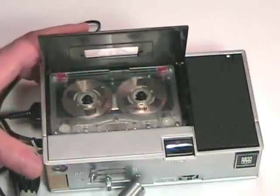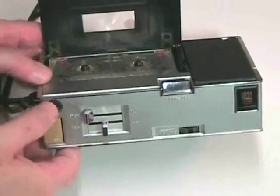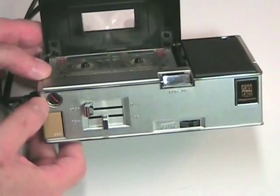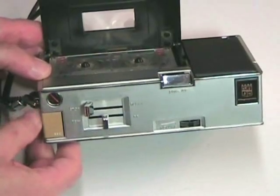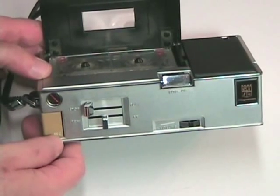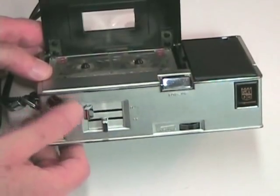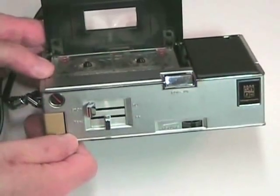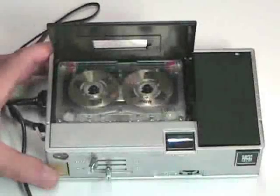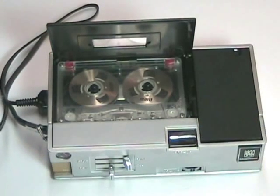The machine has a manual recording circuit. You can see there's a little meter here. The interesting thing about the meter is that it doesn't have any markings on it — it just has three little tiny dots up at the top. When the pointer is straight up and down, it indicates that the batteries are good or that you're making an optimal recording. If the pointer goes clockwise, then you're going a little bit into overdrive. You simply press the record button down, swing over to play, and we're ready to go.